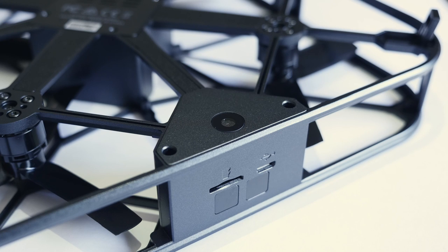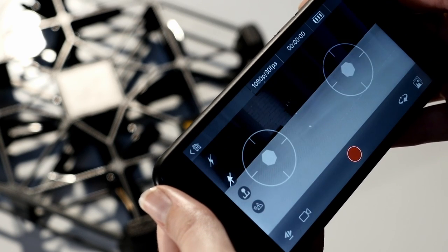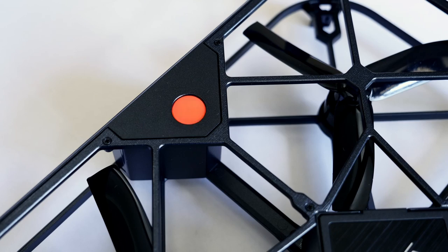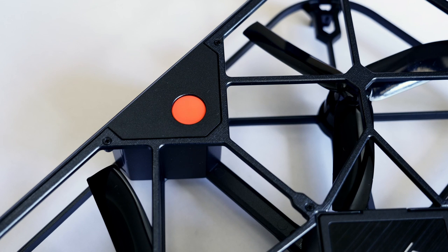Calibration is really important — it resets the sensors so that Rover knows how it's flying. It's important to do it before every flight and after every crash. To calibrate, put your Rover on a flat and stable surface, connect to your Rover and go to the flight screen. Drag the two joysticks down and towards the bottom of the screen, then wait until you see the red activation button flashing and let go of the joysticks. Once the red light has stopped flashing, you're good to go. Check out the app help screen or the setup guide for more information.